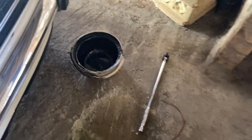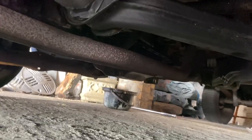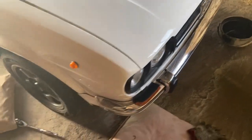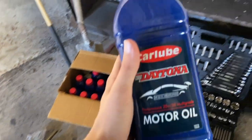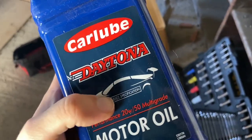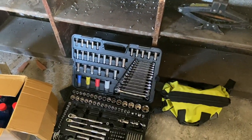Here we can see our little oil pot ready to go. I used the breaker bar to undo the 12mm socket on the sump. The engine is right at the front and the gearbox is on the back on these, so it angles that way and is a little bit hard to get to, but you can do it by feel. I've cracked it off and done it back up. I'm going to run it up so the oil is nice and thin and ready to come out. Here's my new oil — 20w50, which is always useful for other cars, so I bought it in bulk to get it cheaper. I've gone for Carlube Daytona 20w50, the API SE/CC specification, which is the right stuff for the Alfa Romeo Alfasud. About four litres goes in this car.